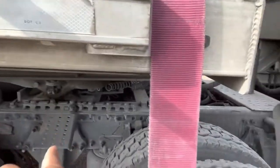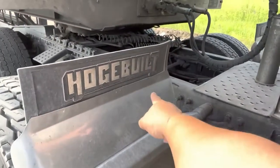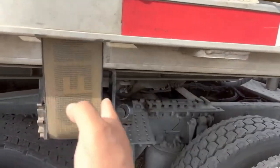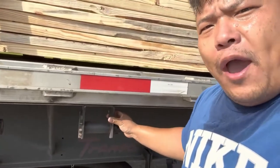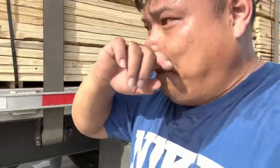So if I move this winch forward to strap down this load properly, when I turn right it hits my fender. You can see a little bulging right here on the fender — that's from the winch going too far forward. That means I have to stay at this point or move back; I cannot move anymore forward without hitting my fenders. Also, on older trailers sometimes these winches are welded onto the frame so you cannot slide them back and forth.